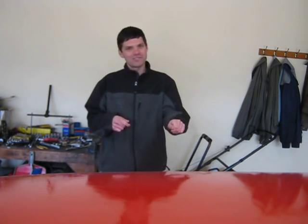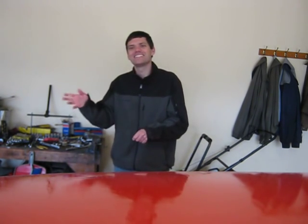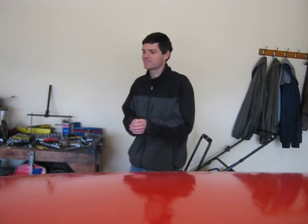So anyways, I put it in neutral, and it was still running the whole time I was going down the hill. It was running really bad. Anyways, I got it into the development, and once I turned into the housing development, it shut down. My engine locked right up, and I had to tow the car here and fix this mess that I have in this video. So anyways, the main reason for that little story was, if you are using used cylinder heads on your old air-cooled Volkswagen, don't be like me. Don't just throw them on and think that they're fine and run them, because there's a chance you'll end up with a blown up engine like I did.